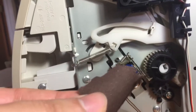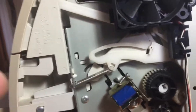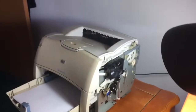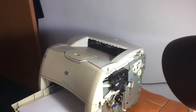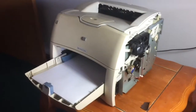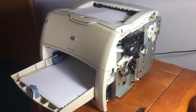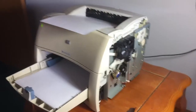All you've got to do is take this screw off right here, take a little piece of cloth, and clean that little area. You'll see there's some gunk in there where it was sticking, and that should basically do the trick - it's done the trick for me. So I had a non-working printer that would jam after one page. Now let me go ahead and print a page and I'll show you it's all fixed, now that I've cleaned that solenoid and put a little piece of cloth there to prevent it from happening again.